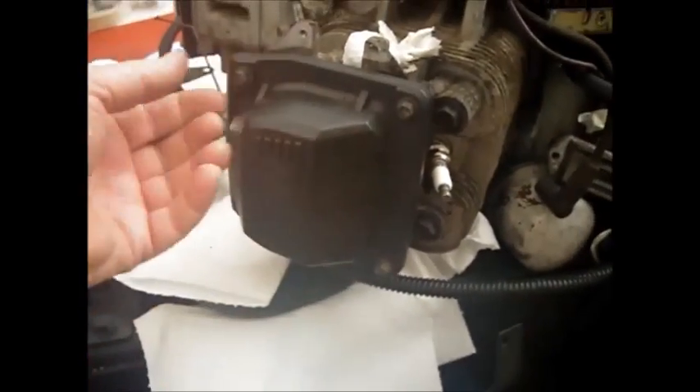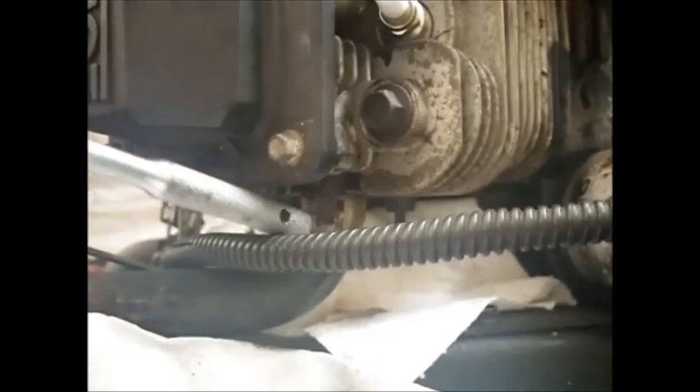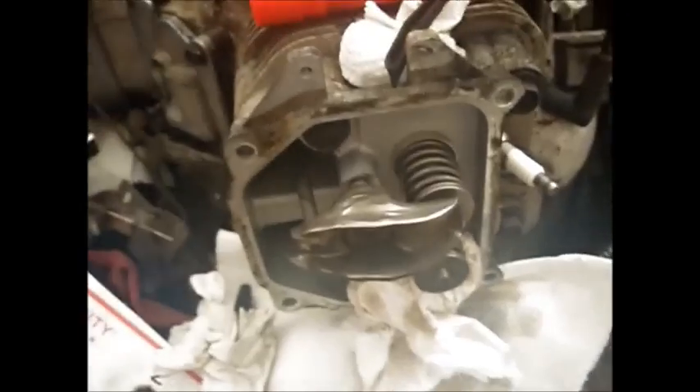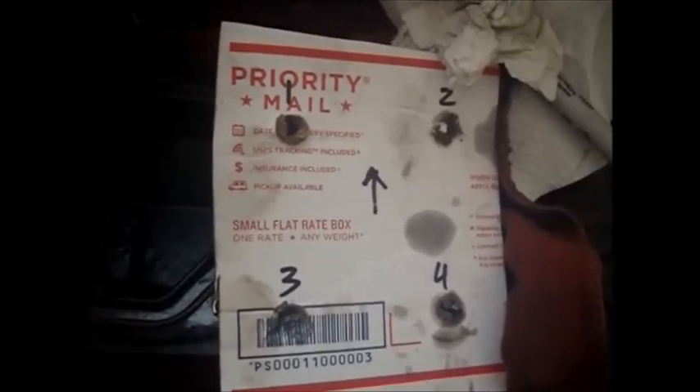Just like a doctor, I gotta make my little sterile area here with paper towels and try to get these header bolts off, take the valve cover off. I found these header bolts - this one is really stuck. But since I did the other side, I know that this pipe will lift right out of here. So I'm just gonna take the head bolts off and lift everything out directly, then take it off after I get the head off. I'm marking them as to where they go so I can put them back in the same spot. Looks just like an operation - got to stop the bleeding.